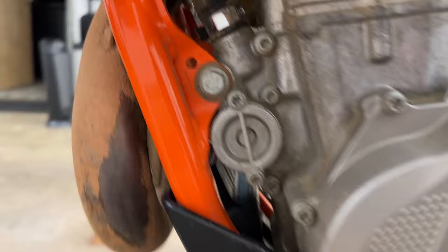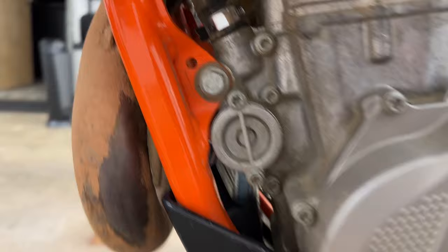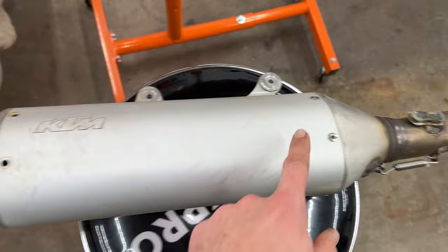That's the new fuel filter in place, looking pretty neat. The new fuel rail is in — you can see it on this side. Now all I have to do is take the header tube off to do the manifold, then put the exhaust back on. They say it's easier to bolt the exhaust back on first and then pop the old cap off to put the new cap on.